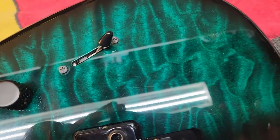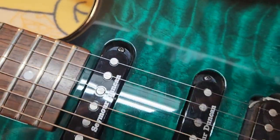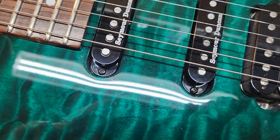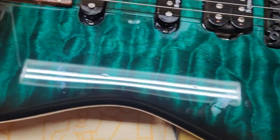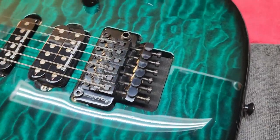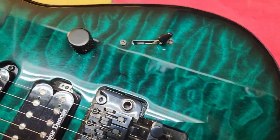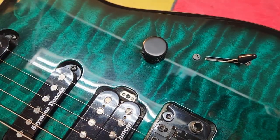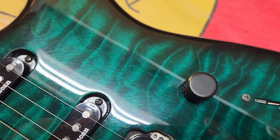It's all normal, but this is all surface. These are all just on the surface, sitting on top of the clear coat, and nothing's real deep. So I don't think we'll have any problems getting rid of it, but it does take a little bit more aggressive polishing than what you can do by hand. Although you can take some of this level of pick scratches out by hand, it's just probably not going to be quite as shiny when you get done.